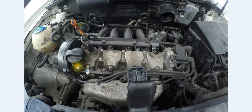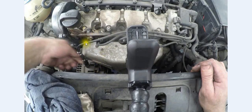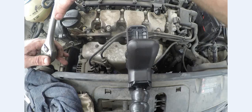Now we have our spark plug wires all exposed. What we need to do is pull these off — just sort of basically pull it back. I use my hands. Sometimes they are very tight and you might need to use pliers to grip it and pull it off, because as time goes by, people may not replace their spark plugs timeously and it does tend to sit and corrode a little bit. Once we've got all our spark plug wires out of the way, we have the tips of the spark plugs exposed. We take our 16mm socket with our extension and a leverage bar and go lefty-loosey to start loosening the spark plugs.